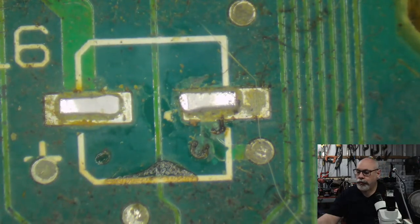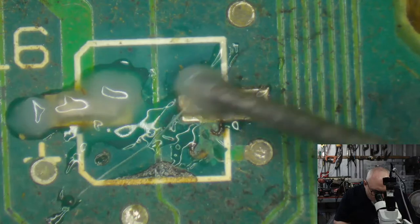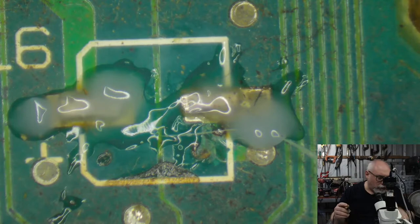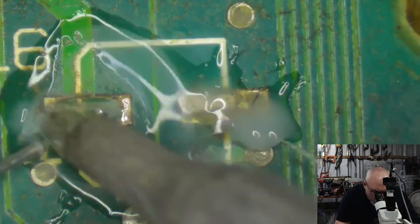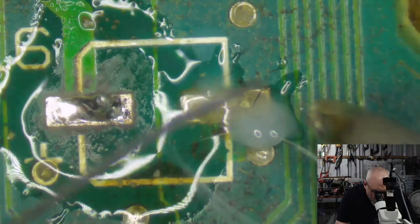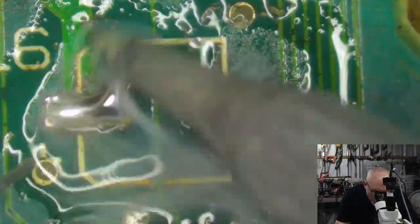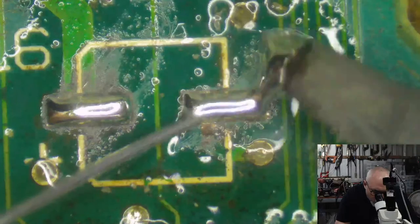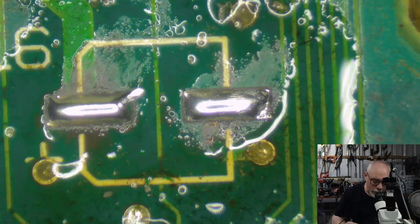Interesting thing about the Macintosh 2Ci is it was the very first modular Macintosh. By modular, I mean one that you could expand, put cards in and stuff like that, as opposed to a compact Mac. It was the first of the modular Macs to have its own built-in video. The Mac 2, the Mac 2X, the Mac 2CX, FX, I can't remember. I don't think the FX had video. This one actually had its own, it's pretty lame, but it had its own video output. So you could plug a monitor straight into the motherboard.